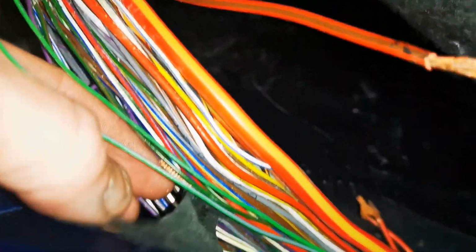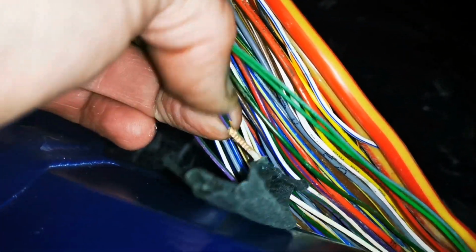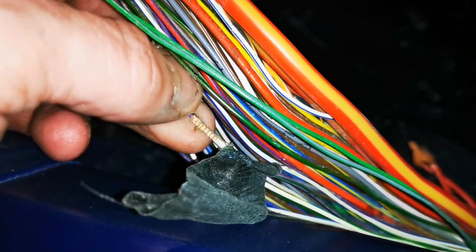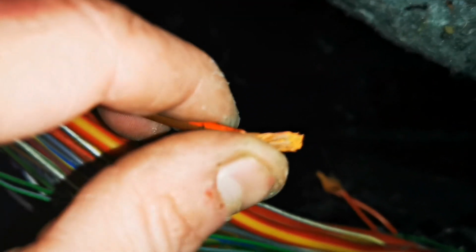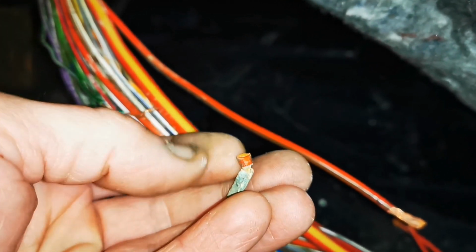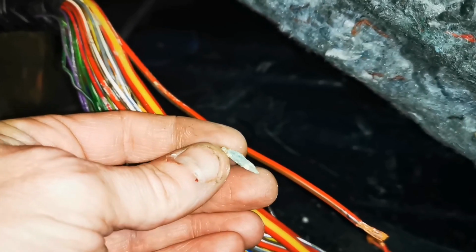So what's going on here, if you take it down here, there's another connection which is still good on this purple wire. And you can see it's like a breech joint, to call it. So there's two wires into one sort of copper crimp there, and onto one there, and there's just that bit of cloth tape around it. So that's just soaking wet, and just rots her out. This main power wire, again, I've stripped that myself, and these two, they were butted onto there with this connection, which was still making. It was still making, but just a quick tug and it pulled apart. And yeah, it's the remains of it.